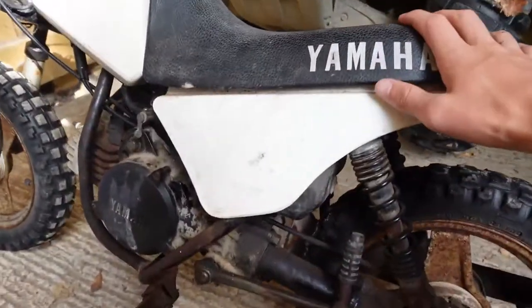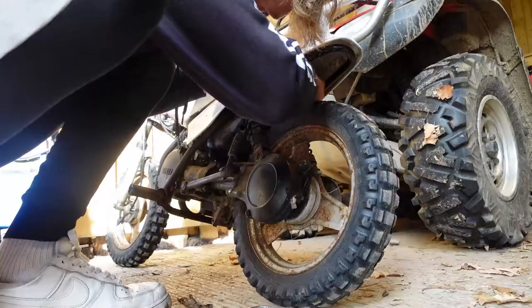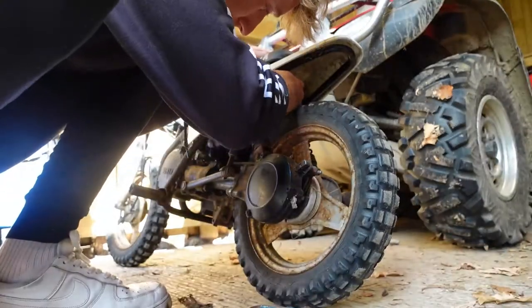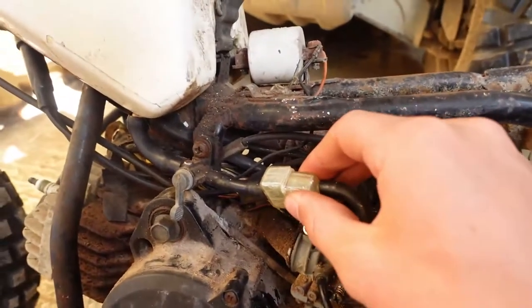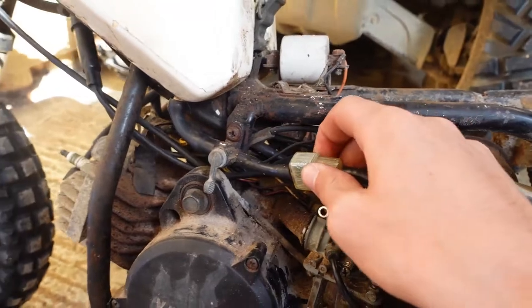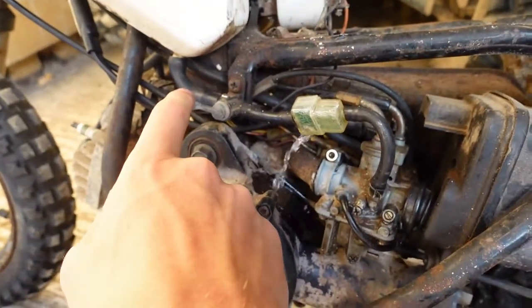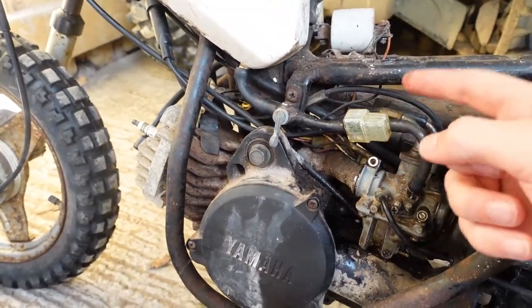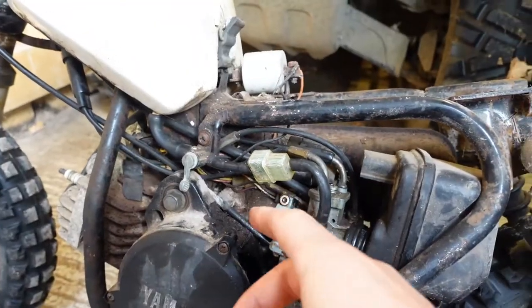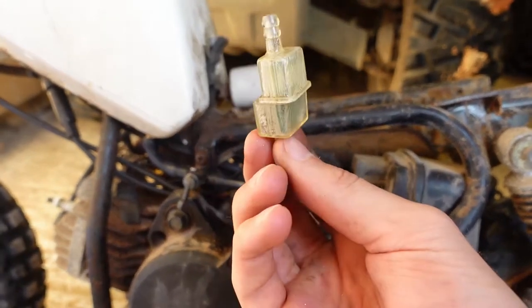I'm going to lean the bike up here so it's a bit lighter and I can see what I'm doing. I'll take these two bolts off, get the seat off, and then the fuel filter should hopefully just pull off easily. Here's the little fuel filter, and you can see it is completely cracked — if we open this, you can see fuel drips right out. That is a big leak, which is massively where it's been leaking from. So let's pull these tubes off, and just like that the filter is now out. Now I need to go and find another one at a parts shop.